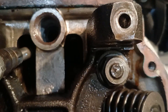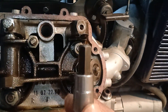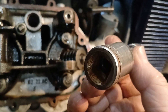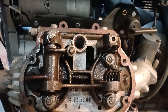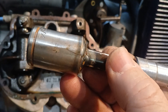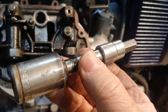Down there there's a nut — it's designed to take that, so that will go down there. And it can be a bit of a bugger; those tend to corrode. If your engine's not been apart before, I suggest you get one of these. When you come to undo it, soak it if you can — with some penetrating oil or some of that freezing ease-off freeze stuff — and then hit it with one of these with an impact gun on the end. I've made this adapter out of a knackered old socket, but you can buy adapters.